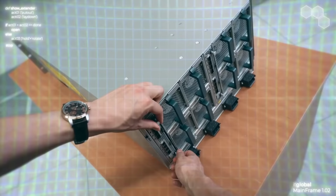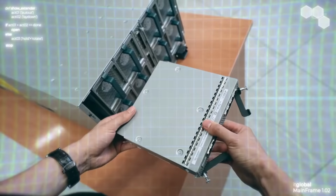2 fabric extenders, or FEXs, are also installed on the chassis. We have IOM 2408 with 8 ports, 25 GB each. Again, they are not switches but a remote line card in relation to fabric interconnect. It means that all 20 chassis with up to 160 servers are connected into a single switching fabric. It ensures minimum latency. A physical server in one enclosure can ping a server on the other side of the rack in another enclosure with one hop.